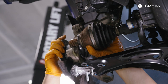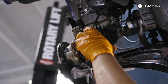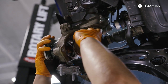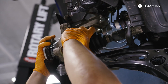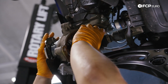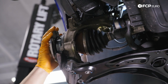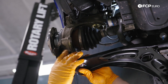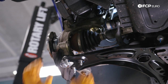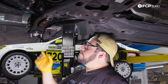Now we can go ahead and work on feeding our axle back in. Take it off the bungee cord, rotate the hub until the splines line up, and then you can literally just tap the hub towards the axle. It almost self-aligned at the ball joint ends. The index marks definitely help with that.